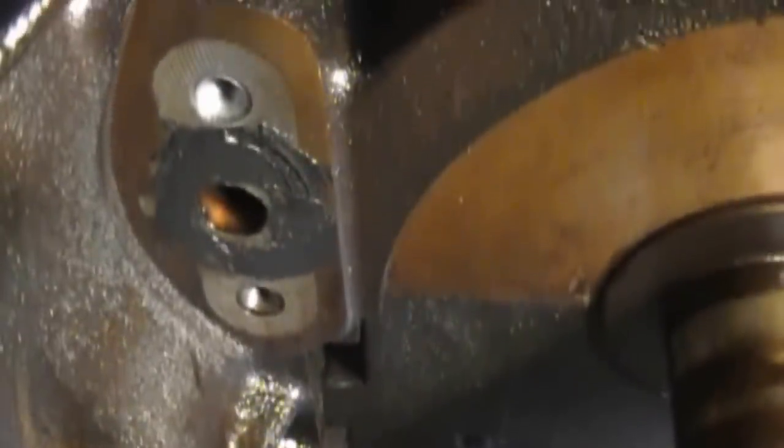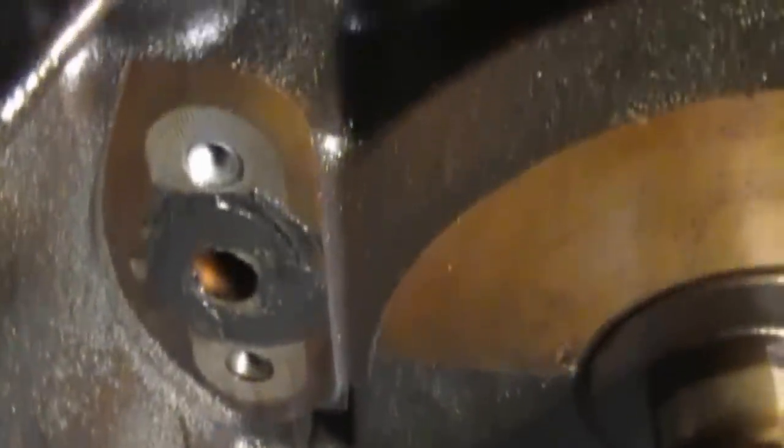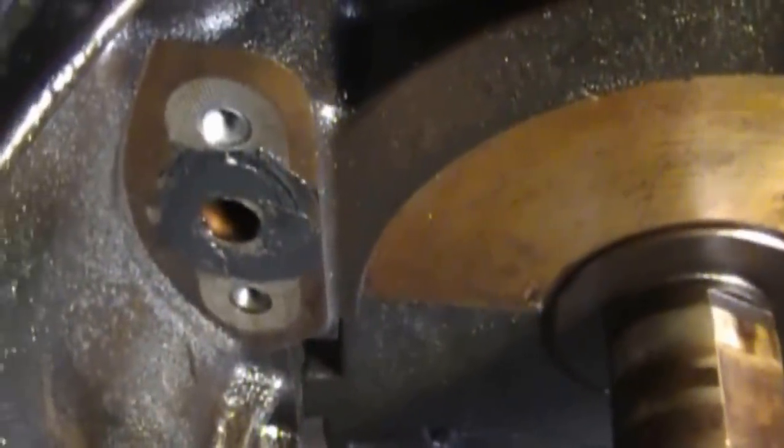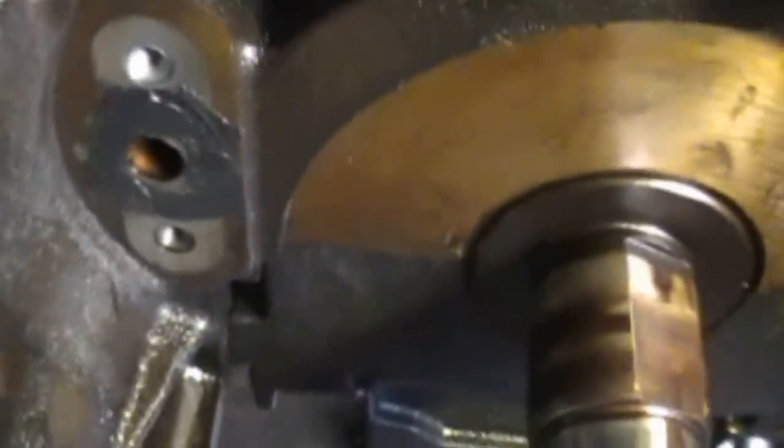Getting ready to stick the new oil pump in - I primed it with oil. Make sure you get oil in yours and prime it real good. I just used used oil since I'm going to change it eventually anyway. On the mating surface where the oil pump goes, I put some dark RTV silicone - they don't give you a gasket, but I figured it wouldn't hurt to have that sealed. It gives it a better tight fit and you don't have to worry about leaks. Maybe give you a little more oil pressure.